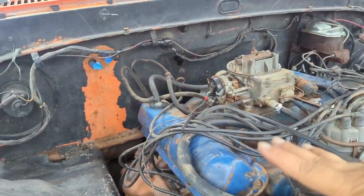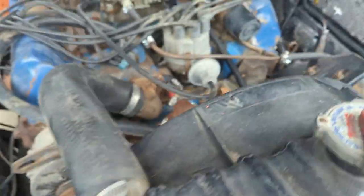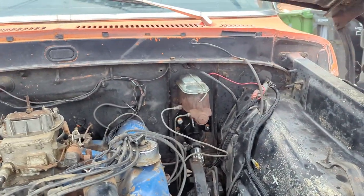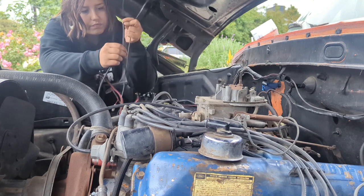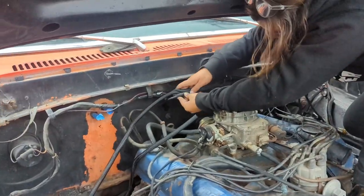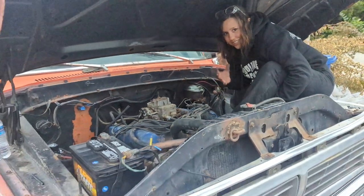The horn works, which is very exciting, except that the wiring for it is too short for the relocation that I'm doing. So I'm just extending the wires and then looming it. This truck is not that complicated when it comes to wiring, but there are some sketchy wires here. You can always tell the ones that I've gone through because they will have a loom on them. I just have to go through these remaining wires, unwrap them, double check, and then loom them so that I know they're good. This is my yoga - very stressful yoga.